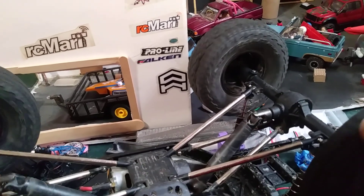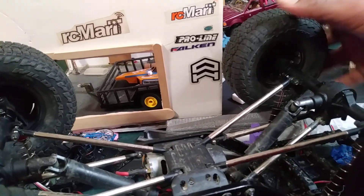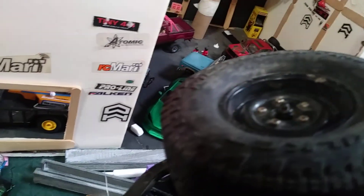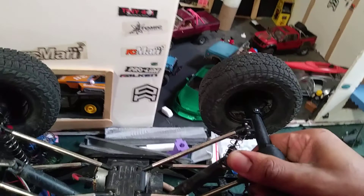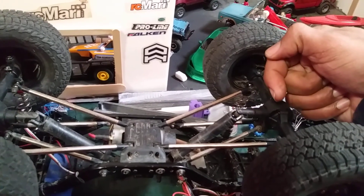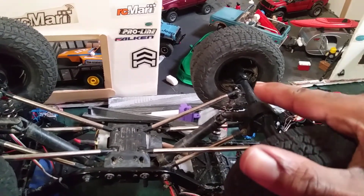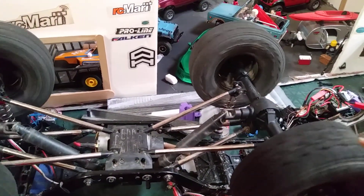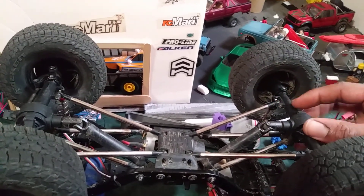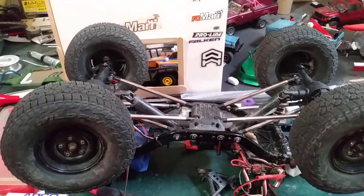I checked the pin and the pin's grabbing, but it's just spinning — free spinning inside. It's turning now, but it's just not catching, you know. I think it rounded out inside the diff where the axle goes in on that little C-channel where it's cut out. That's what I believe the problem is — how these axles go into the diff. So we're gonna take this apart and rebuild these axles; I'm actually gonna try and look for some upgrade axles. But first I want to get that body mounted for him.